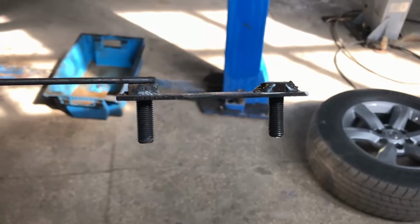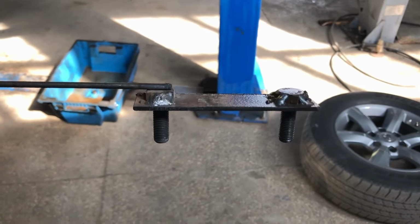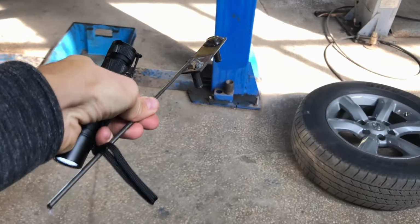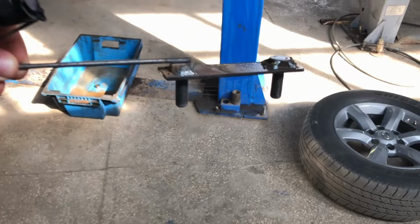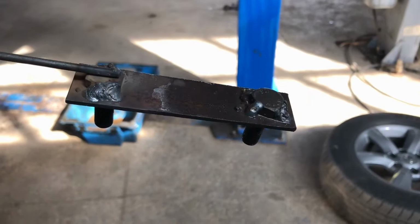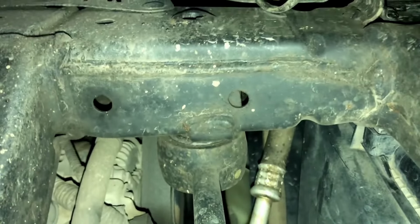The easiest way to solve this problem is to make devices like this. It's a plate with 2 bolts and a handle to make it easy to install. However, to install it, you need to remove the front bumper and the reinforcement. Fortunately, this is not difficult, and it is then installed through the end of the frame. On the passenger side, you need to remove the excess protrusions from the KDSS mount. Well, then all that's left is to fasten it.